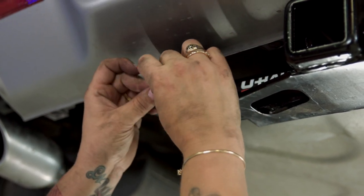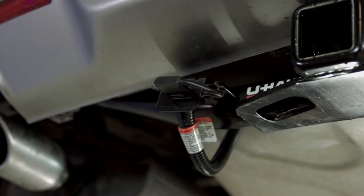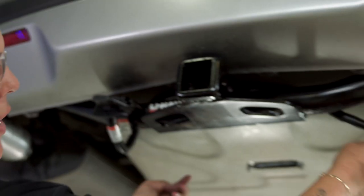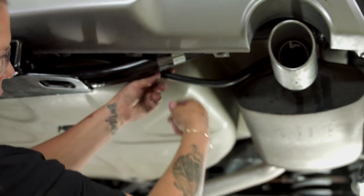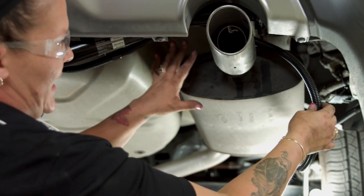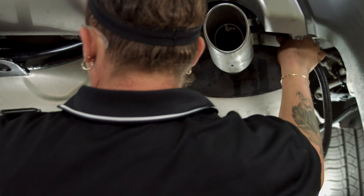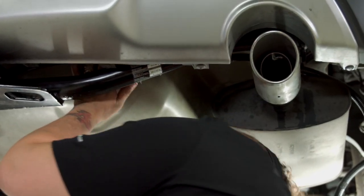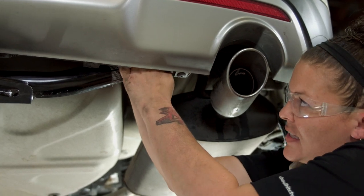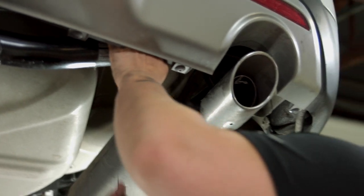Take our nice dust cover — that helps prevent your terminals from getting dirty and corroded. Cover that up. Now I want to take all this loose wiring that's left over and get it tied up away from any moving parts and any heat sources like your exhaust. I'm going to pull this over and zip tie to a wiring harness that's up here, then work my way back to this area.